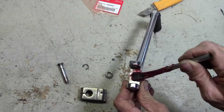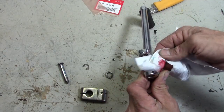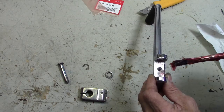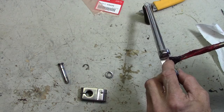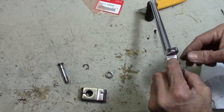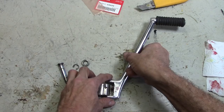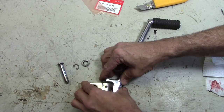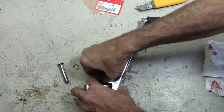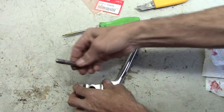I'll pack a little bit of grease down in there with my red grease. Wipe away some of that excess — I don't need all of that in there. Let's put the ball on there and put just a tiny bit of grease on top of the ball to make sure it has a proper amount of lube. Wipe off some of the excess — all it's going to do is attract dirt. The ball's in there, so then this goes in. I'll squeeze it into place and get the spring in there. I'll compress it a little bit with a screwdriver and get the pin started.